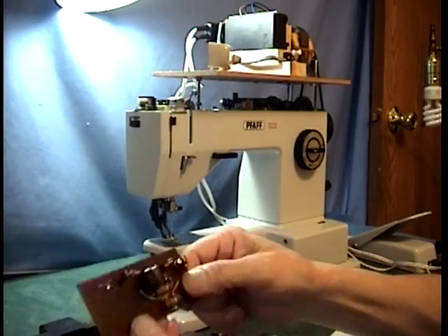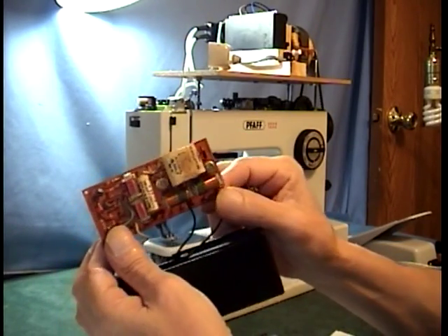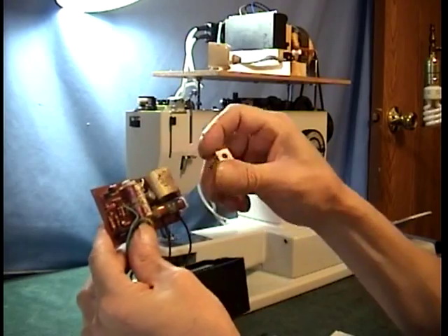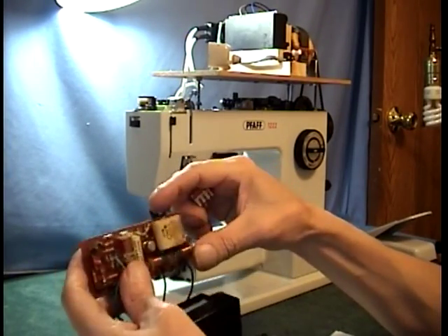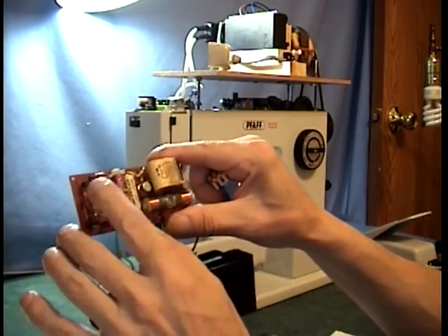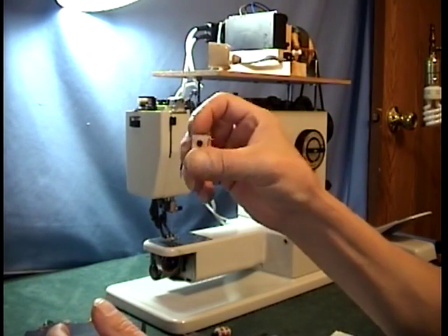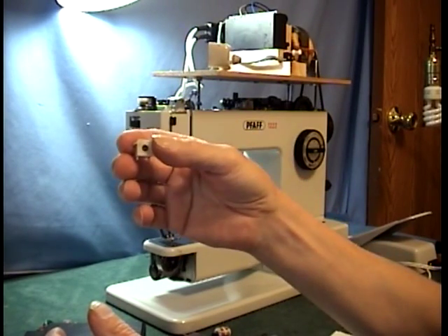That's what's happening to most of the older boards. This is actually a really old board — one of the original types. I call them first-generation boards; FOF came out with these pretty much in the beginning. They have a slightly different coil form, an old three-leg capacitor with two legs in the back and one up front — the three sisters — plus transistors and resistors. The problem is I cannot currently make these up, so I need them off of the old board to refurbish them.